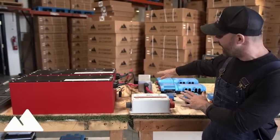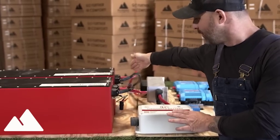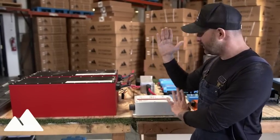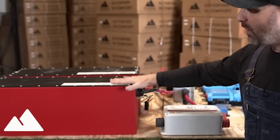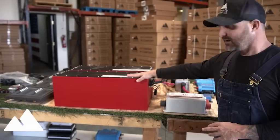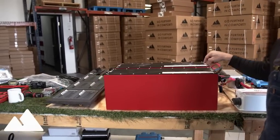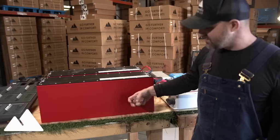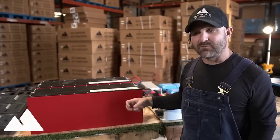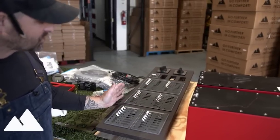You'll see the industrial-grade nature of the Lithionics integrated BMS right here, along with their battery combiner box custom for Lithionics. The third battery hasn't arrived yet, but once it does, it'll go right over there. These are the 51-volt, 110-amp-hour Lithionics batteries with the internal BMS and heater all integrated into this industrial-sized case. Lithionics batteries are the most expensive batteries on the market to my knowledge, and once you see how they're built, you can see that there is no expense spared. I'm very excited to have these in the Zombie Apocalypse vehicle — this will be the heart of the system.